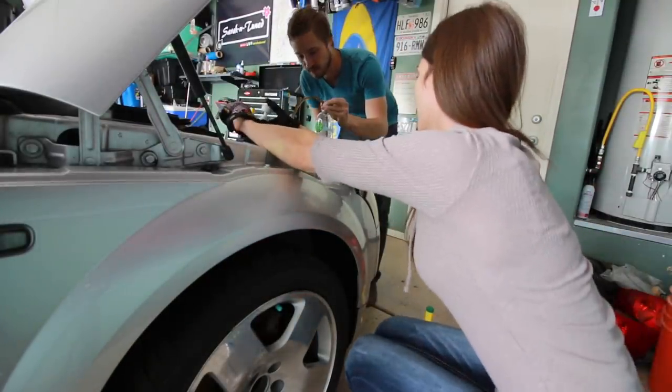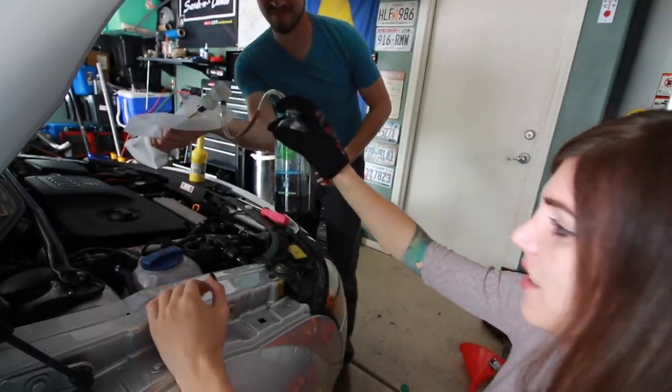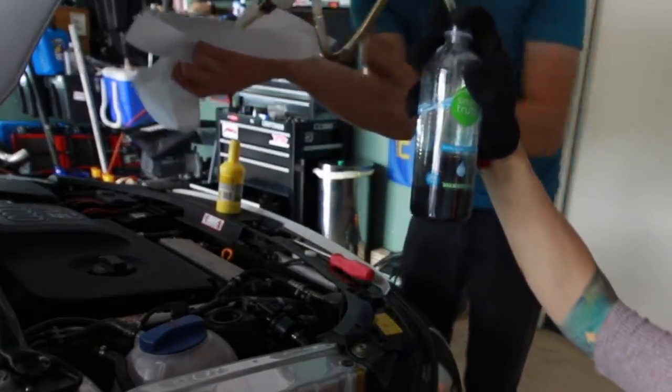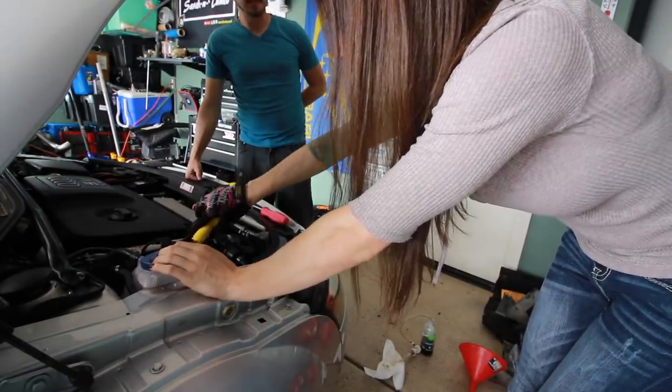Oh my god. That's bad. Wow. Yeah, so fresh fluid is definitely in order. Look at the fluid that came out of there. That is absolutely disgusting. And that was after adding at least half the system capacity of new fluid. Here goes nothing. I'm gonna cycle the power steering some more, keep turning the wheel back and forth, and hopefully I can keep pumping out the old nasty fluid that's in there.